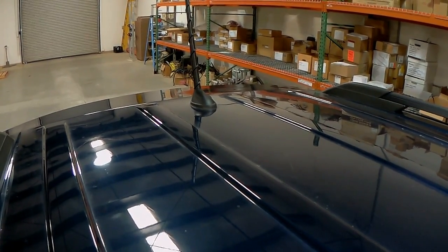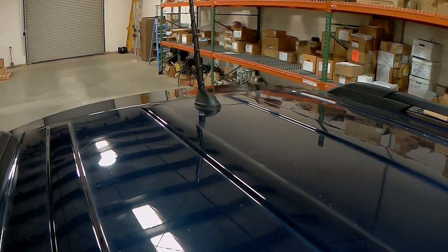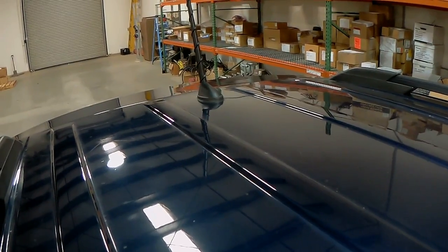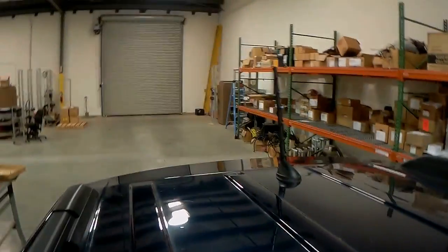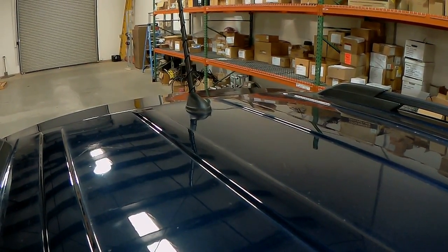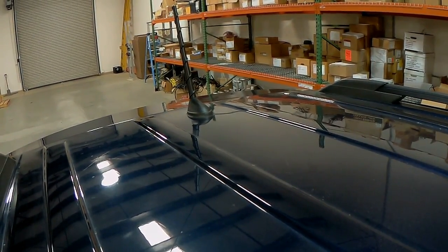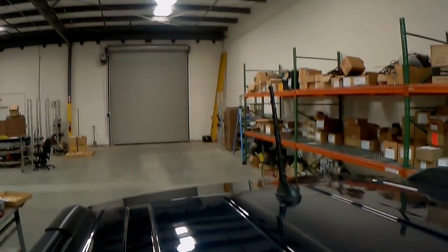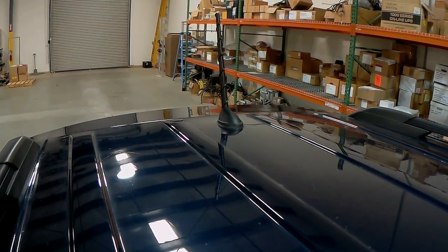On the 800 MHz radio I do have repeaters — interoperability channels, local law enforcement, and others. There's a repeater about 40 miles away in the direction of the garage door back there. Other than the cinder block walls, steel roof, and garage door here, I don't think there are major obstructions. I'm transmitting now and you can hear the clear kickback from the repeater.